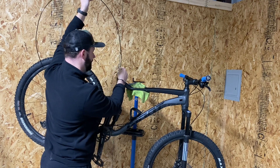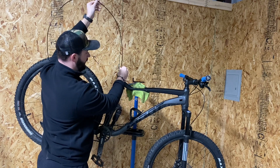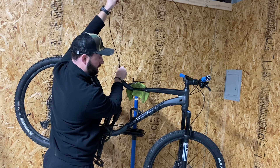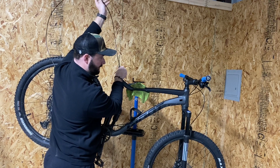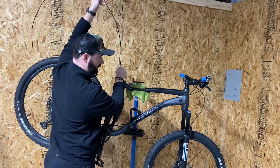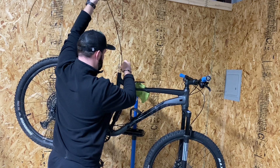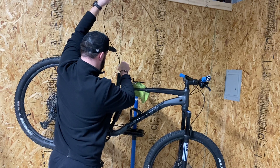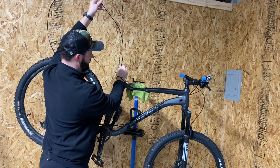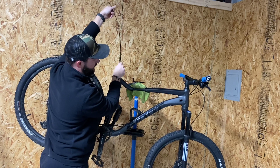That's the cable hitting on the bottom bracket. There's actually a little channel down in there that will let you get past it, but you kind of have to weave it a little bit. Hold on to it and just apply a slight down pressure and kind of twist the cable over your head and you'll feel it drop. Of course it did this way easier the first time, so it's going to be difficult to show you. There it is — you're going to have to pick it up, reset it, and spin it, but you'll feel it slide down in there. Give it a little bit of pressure, continue to turn it a little bit, and then you'll feel it slide.